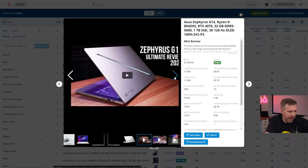So, notice that our score now is worse on the Omen 14 after its thermal throttling. 17,000, we dropped about 600 points down. But without thermal throttling, the Omen 14 was a little bit faster. The thermal throttling on the G14 is not affecting our performance much at all because the power limit is staying so consistent. But might be a little bit, because we were at 80 watts, now we're at 76, 17,127. So this is a good example of how thermal throttling can reduce your performance by a little bit, but not by a huge margin.